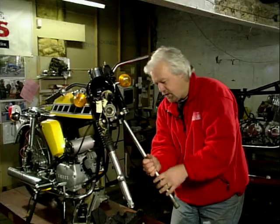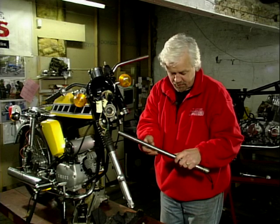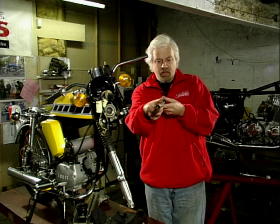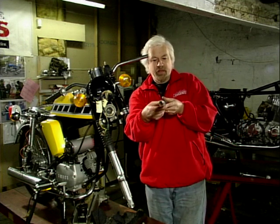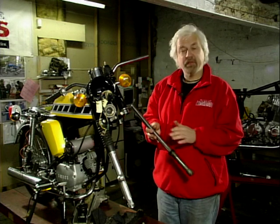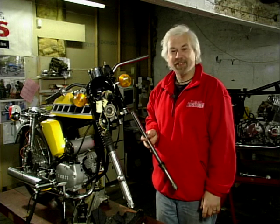And there it is. And you can see there's actually been signs of bodgery on there too. Someone's had a go at this in the past. And you may be able to see, if I sight that up that way, you can now tell how badly bent that is, and that wasn't obvious on the bike. In order to repair that, I'm going to have to replace both of these two stanchions and simply bolt it all back together, and that's the bike fixed.